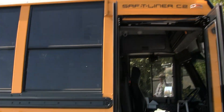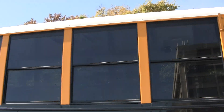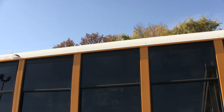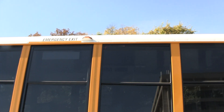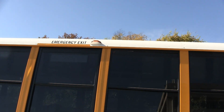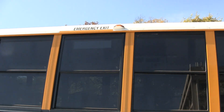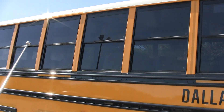As I talk about the top of the bus, I have my clearance lights — two amber in color, one red to the rear. Clearance lights are not cracked — it's security mounted. Then I have my emergency exit; it's legible, and I have reflective tape. I have two emergency exits, one here and one there. The lettering is legible.